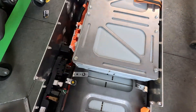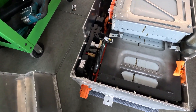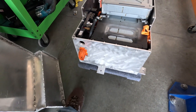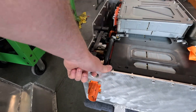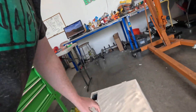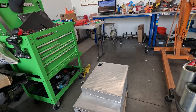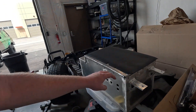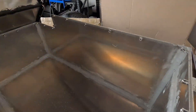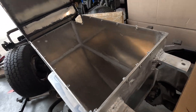The BMS is going to slot down in there. I've got some holes for pass-throughs, and we have the contactor box here bolted up. We've got the main plug on the front and the hole for the BMS wiring. All in all that's coming together really well, and I used a brushed aluminum look on there — I think it looks pretty good. The other box I haven't done the brushing yet, but you can see we've got seam sealer in there and all the riv nuts installed all the way around.